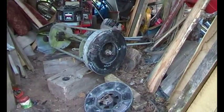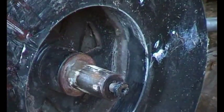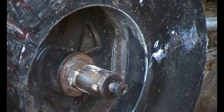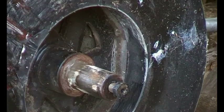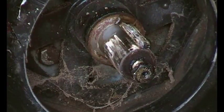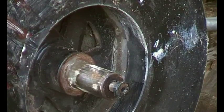So that was amazing, wasn't it? You need a lot of heat to get that bearing fit to let go. A lot. And this is one of the primary reasons why I sought this turbine out, because until you see how it goes, you're always very tentative. Let's just have a look at the size of that shaft - just a little under two inches. It's quite warm. And a massive key, absolutely massive, as wide as my little finger. So those people with proven turbines who want to do something with their generators - there you go. That's how to do it, or that's a good start.